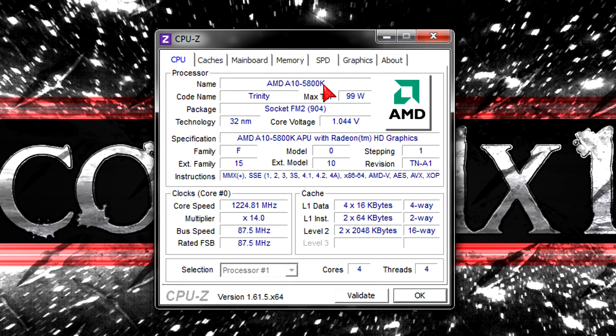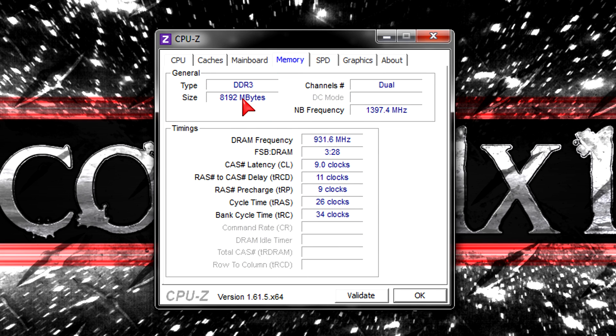As you can see in CPU-Z, the APU is detected without any problems. The voltage is very low and the latest instructions are supported. To save energy, the APU runs on lower frequencies at idle instead of constantly staying at 3.8GHz. The A10-5800K has an unlocked multiplier, making overclocking very easy. I have a DDR3 2000MHz RAM kit installed, but couldn't get it to run at the rated frequency without overclocking the platform, so it's running at 1866MHz.